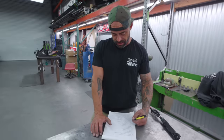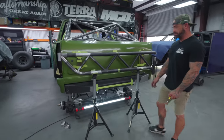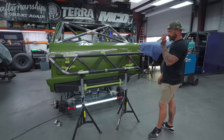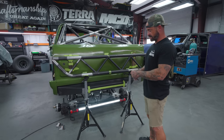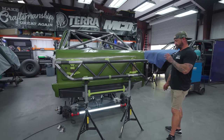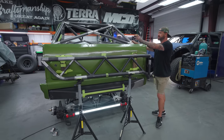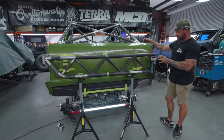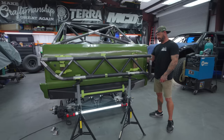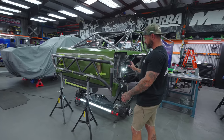So: limit strap tabs, rear bumper, tailgate storage, tire swinger. In part one or two I mentioned the truck came with a bumper and tire carrier swing-out that weren't bad — meaning there's hope, not a design that's completely botched. It's something we can R&R and get something optimal out of. Right now we have the fuel cell can in there, the hold down structure, some tin work done. This portion needs to be done before we start tinning the external rear chassis because it's going to hold two 39s or 40s — sufficient weight and leverage that needs to be tied into actual tube, not body or tin work.